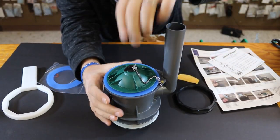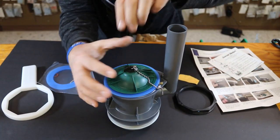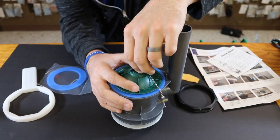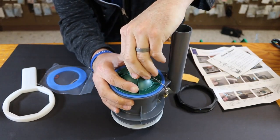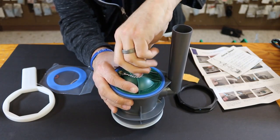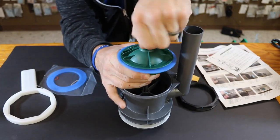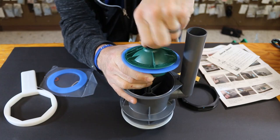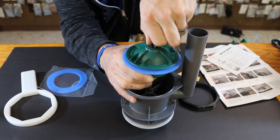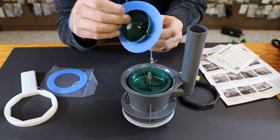To change that out, flush the toilet, turn the water off, and get that water out. This little thumb screw twists to the left — it's going to give you a little bit of a pop because it's got some notches to hold it in place. Then just continue to screw that and it comes loose. You would then remove the gasket.